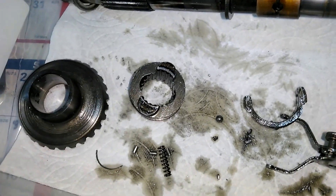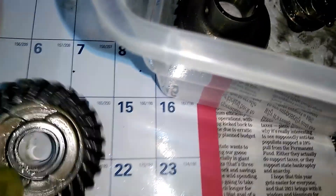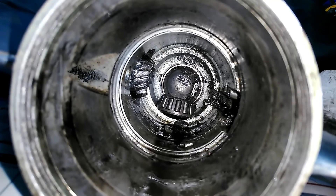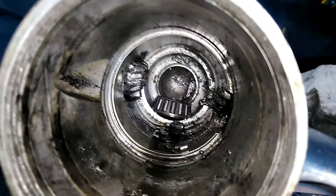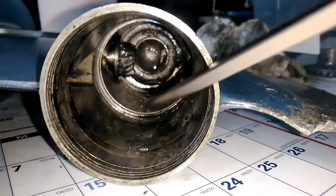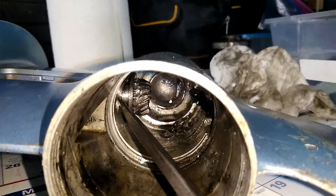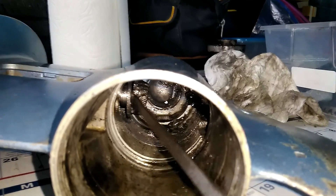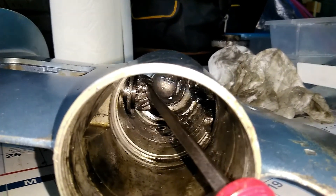I had a little trouble figuring out what it was hung up on, so I took the reverse gear off. Now I'm able to slide the shaft out. I pulled out the clutch dog and the shift lever attachment, along with some small ball bearings and the spring. Forward gear I was able to pull down and under the pinion — it's destroyed. Looking in there, the pinion's destroyed, there's metal everywhere. That bearing's probably shot. It looks like one thrust washer is gone and the bearing's just destroyed.